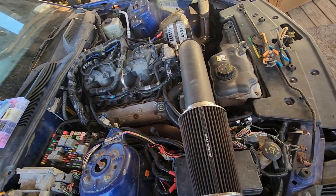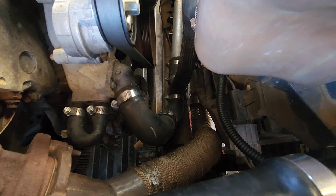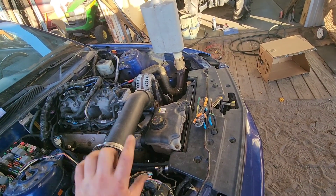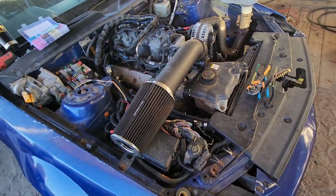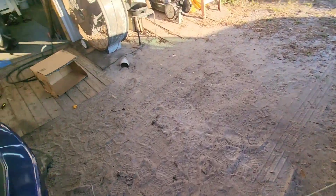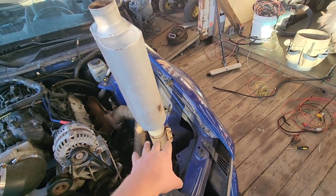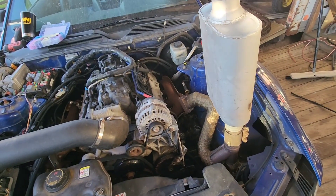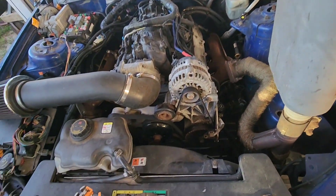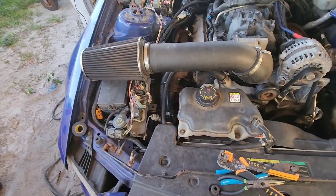Next order of business — tomorrow I'm going to work on the sway bar link. We had to drop the sway bar link to clear the crank on the front of the engine. The sway bar is just hanging right underneath the crank. I got plates that go on the factory mounts — drop it down, it just moves the bolt holes down about an inch. Make those plates, bolt them up, and that should be good. After that we'll keep working on the small things. Hopefully get the turbo ordered soon and start working on that. I think I'm going to run it with no intercooler for now and just not run crazy timing. The turbo is going to go on here straight into the intake — exhaust will just shoot out the hood. We're going to do de-capped injectors. Basically you take the stock Chevy injectors, grab a bunch from the junkyard, grind all the caps off of them to get more flow, then flow test them and find a set that are matched. Then we'll upgrade the fuel pump in the tank and should be getting pretty close after that.